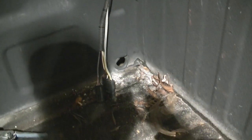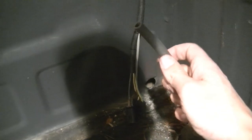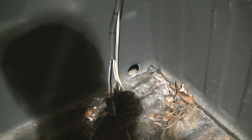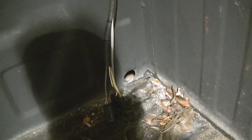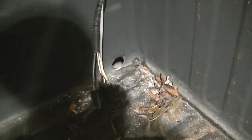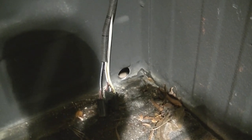I just drilled a hole in the bed to run my wires in to connect them to my bar. I have a piece of vacuum line that I split — I'm going to take some gasket maker or silicone and run it all the way around, then stick this on there so the wires won't get chafed. I don't have a grommet that big, so this is what I'm doing. Right now I've got my backup lights and parking light wires, and I still need to run the strobe wires.